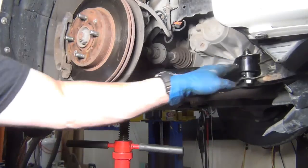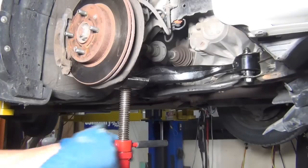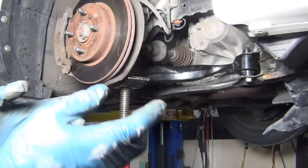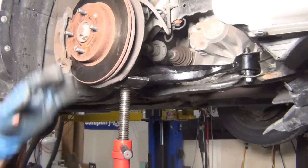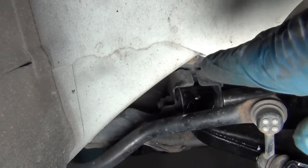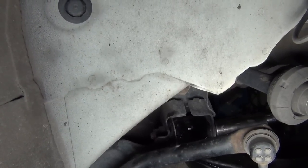What we're seeing now is I've got this jacked up to where it's pretty much level. I'm going to get it jacked up a little further until it starts to lift off of the lift on this corner. And that's just about dead level. That's the way the car sits when it's sitting on the ground. You want to align a car so that it is aligned for when it's sitting on the ground. It doesn't do you any good if the wheels are straight when it's on the lift and funky when it's not. I'm going to go in with an extension and we're going to tighten this bolt back here. So the rubber that's in the bushing on this when it goes up and down is going to be assisting in the torque. It works kind of like a rubber spring and it affects your alignment. That's why we're doing all this fuss.